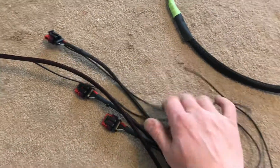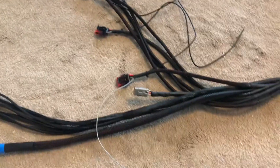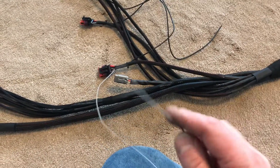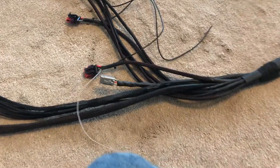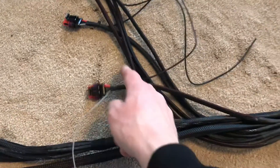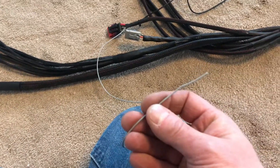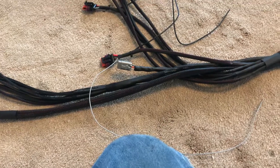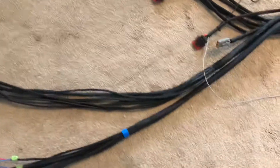High up on the firewall comes out across the back of the valve covers and breaks out to cam sensor and the IGN 1A coils. These are cylinder head grounds that'll get wrapped up. We always have a hard time on the dyno getting a tach signal using the spark plug wire, so I'm using tach output from FuelTech and we'll wire that into the DynoJet setup from Mikey's shop.